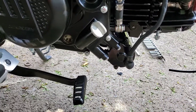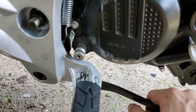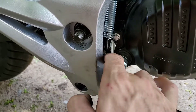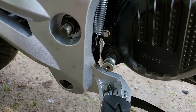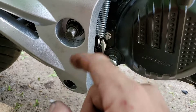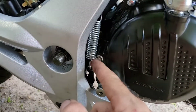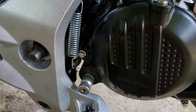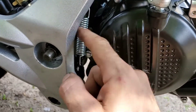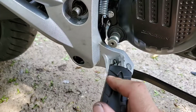With the rear brake pedal — a lot of people say just cut it off and it'll return on its own, but I wasn't a fan of that. All you have to do is notch off the front loop and leave the back loop, then hook your chain up. Yeah, it rubs a little bit on there but that's nothing serious — you might get some paint scuffing. At least you still have your return spring.